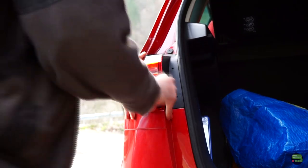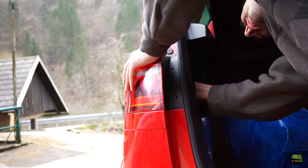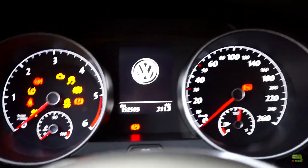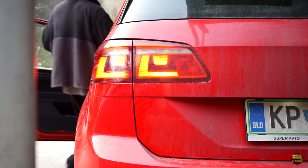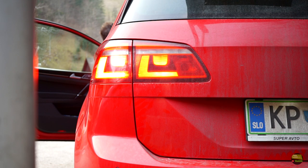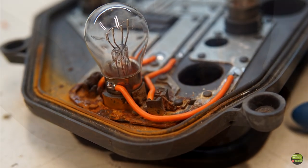When mounting, just be careful that the hooks from the bumper are in the light groove. Then just tighten the plastic screw and plug the connector. After starting the car there was no bulb fault anymore, and the stop light works as it should. I asked at a service for that part — it costs about 30€. Not that expensive, but I hear it's a common problem on Sports Van models. So why buy the same part and support a bad product? Why buy new if it can be fixed? For the entire fix including filming I didn't need more than an hour. So far it worked, but if the fault repeats, I will do a solder fix like on the Fiat Stilo — that fix is forever. You can see it on the link below.